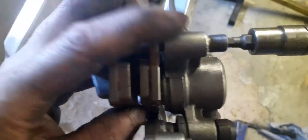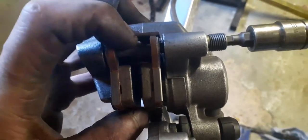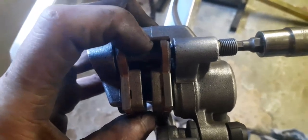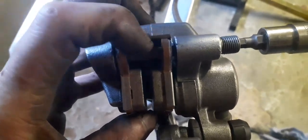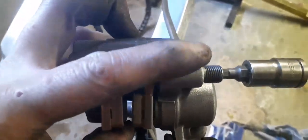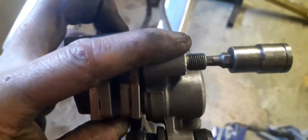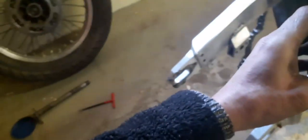I'm gonna turn back in this slide pin here. I don't suggest you put copper grease on here — I don't know why people put copper grease on here. It causes the brake pads to slide around and can start to eat away at the shaft itself. All you need to do is clean up the thread and put Loctite on it. As you can see, there's more than enough room to squeeze the wheel back on.